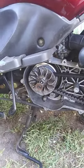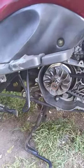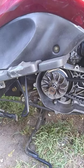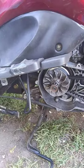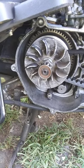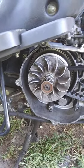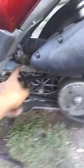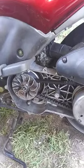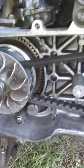I'll make another video because I have to switch out the rollers. I had five 3-gram rollers in there, and I took out two of them because they were so warped — I'm waiting on replacements in the mail. So there are three rollers in there right now. Usually if you have five in there, you start out kind of sluggish. Tuning one of these also involves your carburetor here — you've got your idle screw. There's a lot of play in the gearing, and as you can see from the black line, my belt is not riding all the way up like I want it to be.